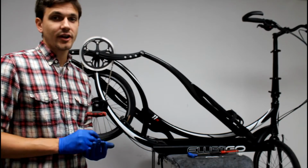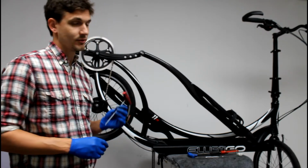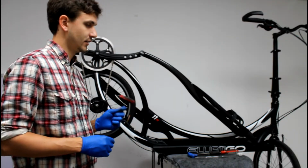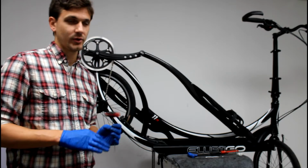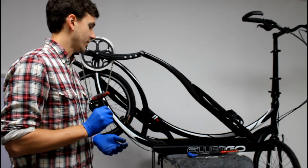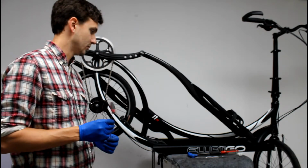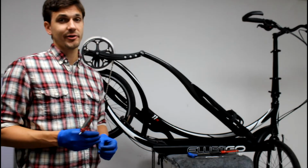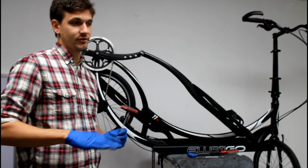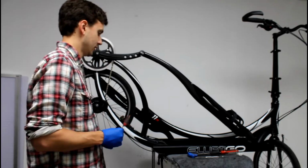Alright, so now we're going to talk about replacing track inserts and load wheels. You'll need to replace the load wheels if the bearings go bad, if they're very dirty, worn, cracked, what have you. Track inserts are a little bit burlier, they last a little bit longer, but if they get any deep gouges in them somehow, or if they're just very worn to the point where there's none of the original Teflon coating on them, it's a good thing to replace.